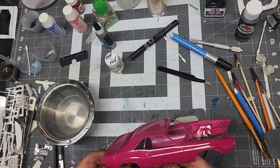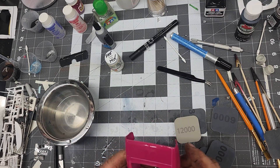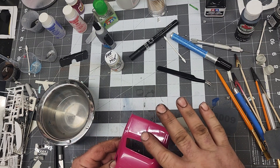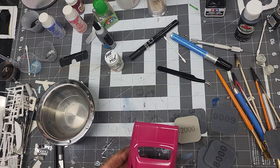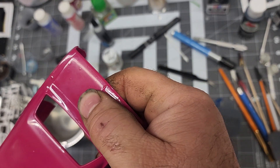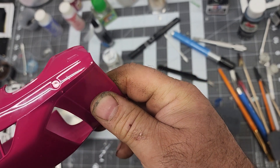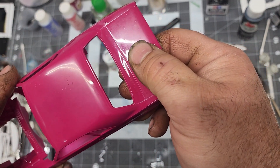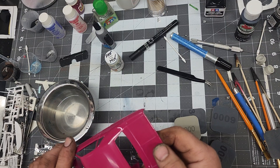Alright, we're going to give the whole thing a once-over. The biggest thing is you've got to really watch these high points — if you press down on them while sanding you're going to take that color right off. Let me get it in the camera — yeah, see those spots right there, a little bit on the rear quarter. There was one on the roof here that I already polished out.